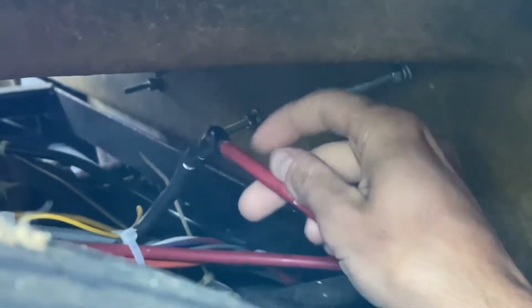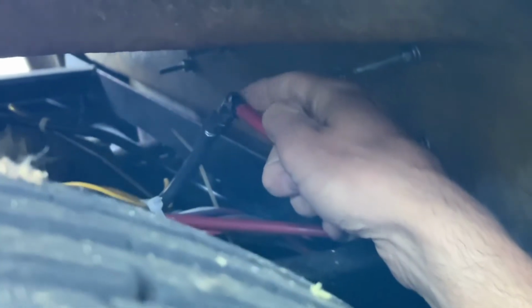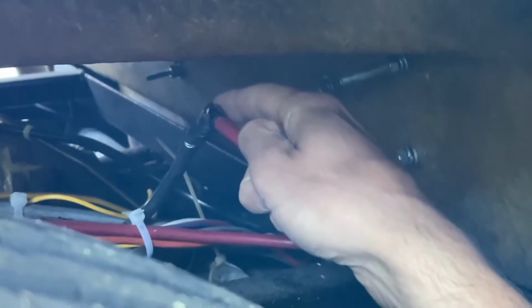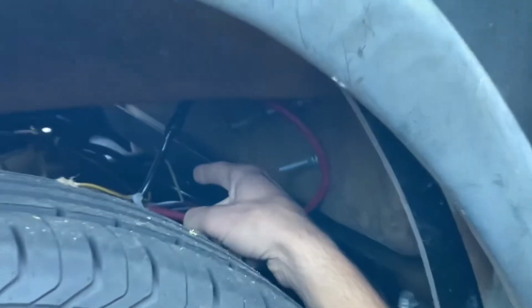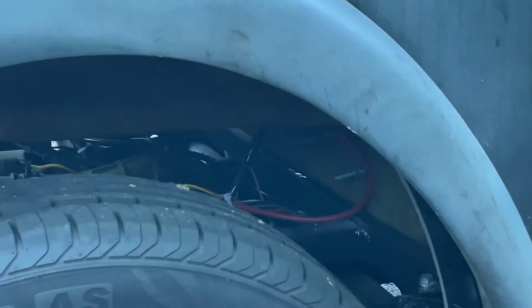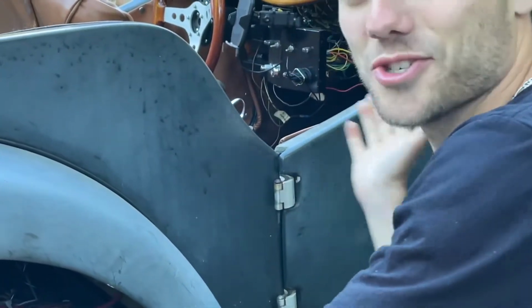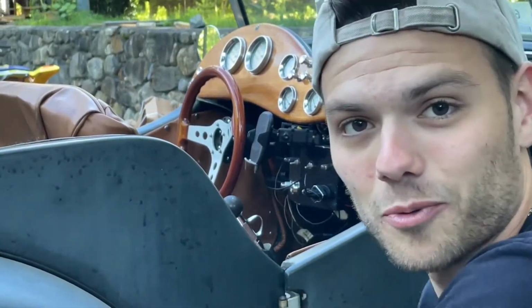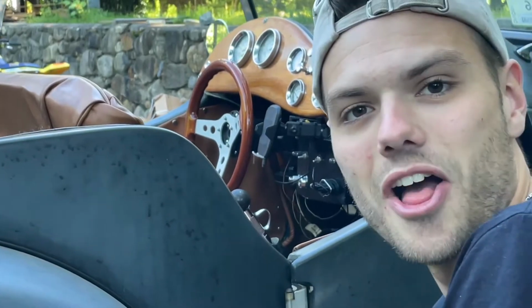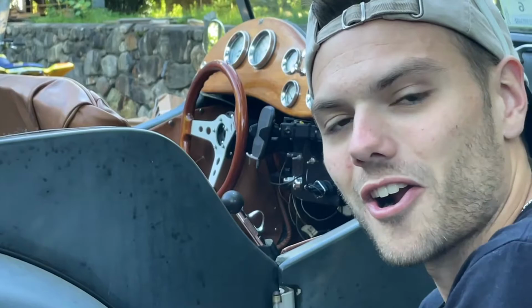This right here is a red cable, and it goes into this electrical tape that has the bolt inside and has the copper sprayed around the bolt. Now out of that comes a black wire, which then goes to the starter. And that is not safe at all. What you should do is just get a different wire that's an extra 2 feet and install that in the first place, and never have done what I did. But instead, that one bolt has yet to fail me to this day on starting this car.